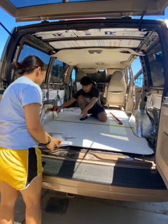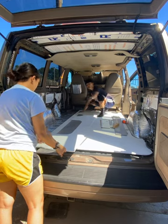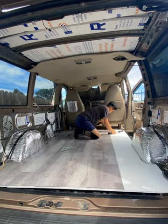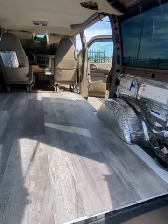After finishing the foam insulation, we moved on to vinyl flooring. We used the subfloor to stencil out the far left side of the van — around the wheel well and gas tank — and used a jigsaw to cut the vinyl flooring to fit. Instead of buying a kit with special tools, Hani used a wood block and a hammer to connect the pieces. Full transparency — a couple months after this, we removed all the vinyl flooring and reinstalled it a different way. As a tip, we'd consider where the bed and cabinets are going first and skip putting floor there. Here's a final cost breakdown: $110 on the subfloor, $56 on prepping the floor and filling holes, and $400 on insulation and sound deadener, for a total of $566.